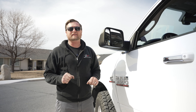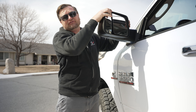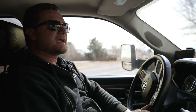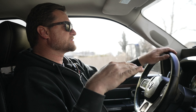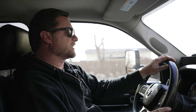Ram owners, you are in luck — finally a reason to put your tow mirrors out without getting made fun of. You want to make sure your mirrors are adjusted so you can see the trailer wheels, and take turns nice and wide, kind of like you would in a semi truck. If you turn too sharp, the trailer has to follow you and cuts the corner — you risk going over curbs or hitting things.